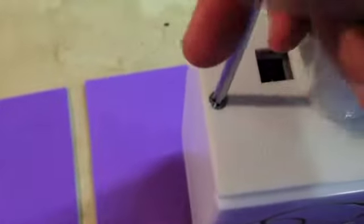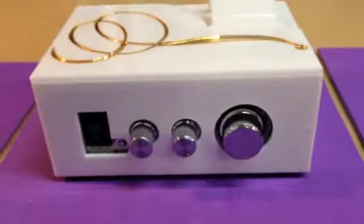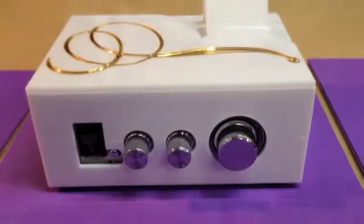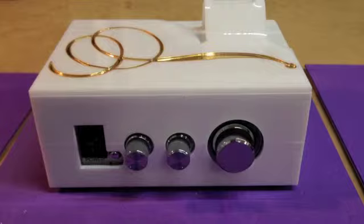And there's not too much more to it. The only other thing you're going to want to do is just check your settings on your new amp as you move things around. Make sure the master volume is at about 3 o'clock if you're in the US or Canada, or about 1 o'clock if you're on a Euro or 240 power standard. And that's about it.